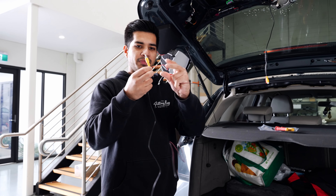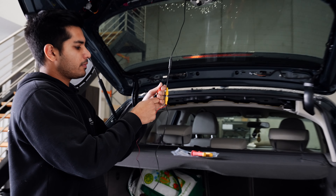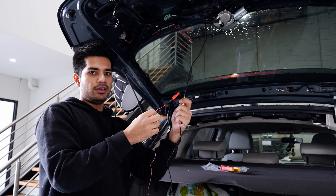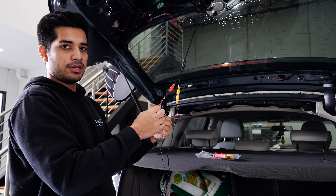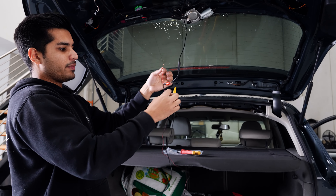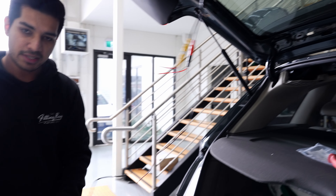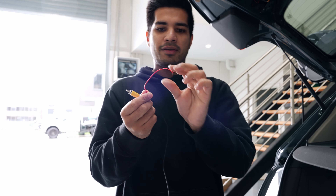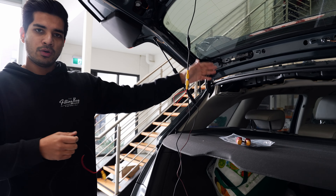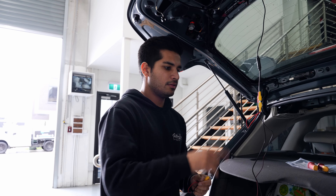Now for the wiring - you've got two parts: the video cable, and there's a little red cable coming off of that which is going to plug in here, yellow to yellow. Then the power cable - I've separated the power cable. That black wire is ground, so that can go to a bolt, but we're not going to connect the ground because usually they just ground through the video, and actually grounding this can create interference. So first thing you want to do is not ground it, see how it looks - if it's perfect, awesome; if not, you can ground it. The red is going to go to the red on the RCA - that's camera power. Get this soldered up. This cable you're running to the front has a red cable at the other end, so whatever power we give here will end up there - we're going to go power from the front, and video from your display, CarPlay kit, or module.